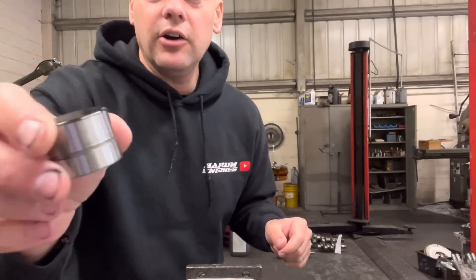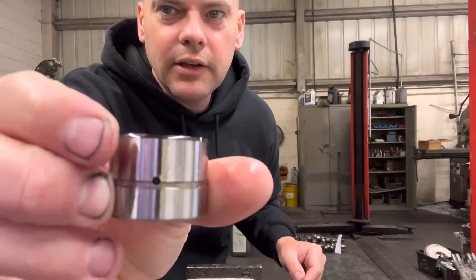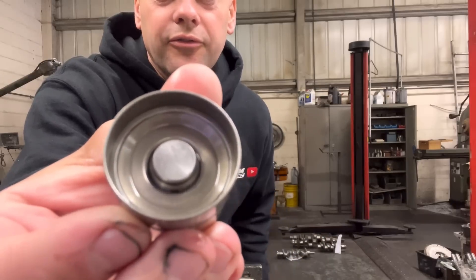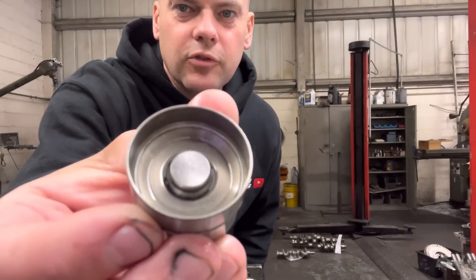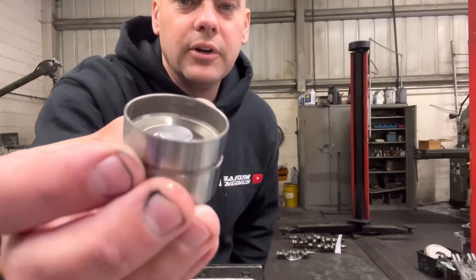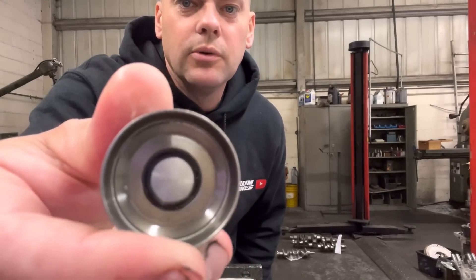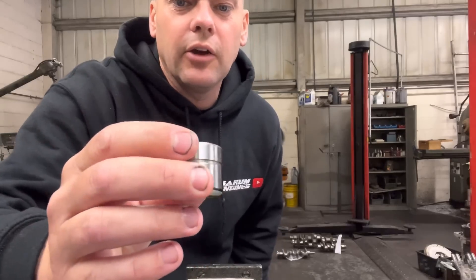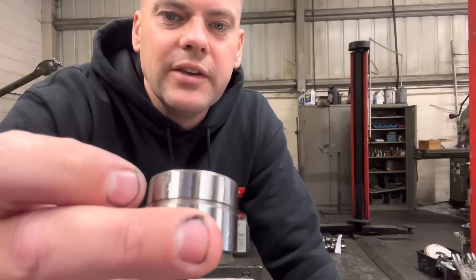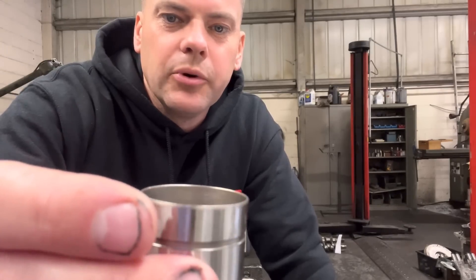So what we've got here guys is just a normal vice. These are our hydraulic lifters - you've got the coating on the top. How they work is from the cylinder head it sort of injects oil under pressure into here, which you've got a plunger in the bottom with a double sort of ball valve chamber in there - it's just a spring and a ball, and that jacks out. It's a one-way sort of valve. That sort of jacks out, takes up the clearance, makes the camshaft work as it's going to and as it's meant to, and doesn't give you any tapping noise. So what we're going to do is squeeze the fluid out of that. Now because it's a one-way valve you need to be very careful how you squeeze it out - very, very slowly and the fluid will come out.